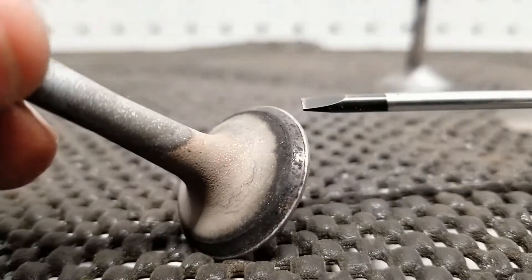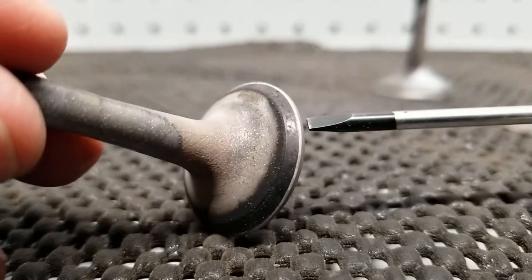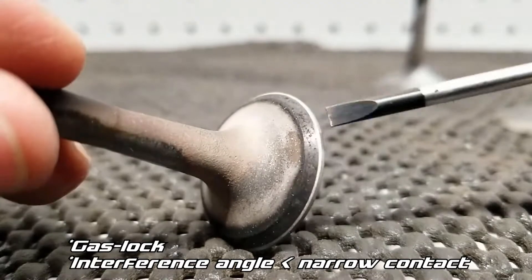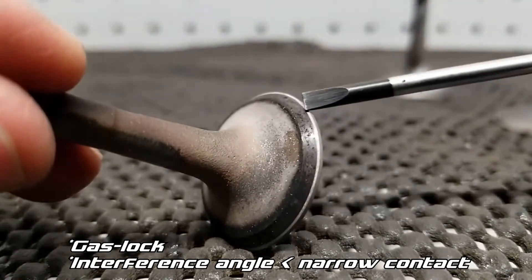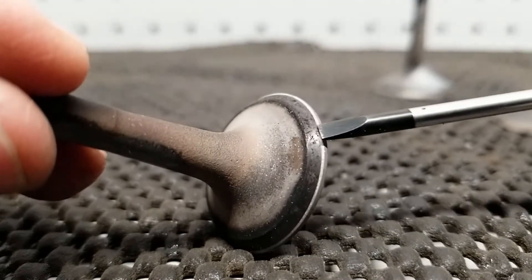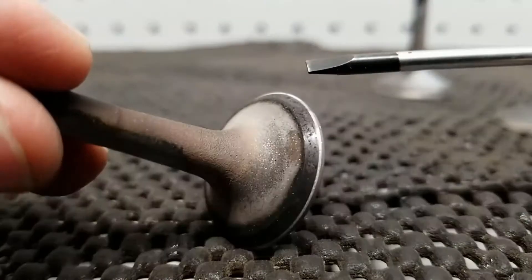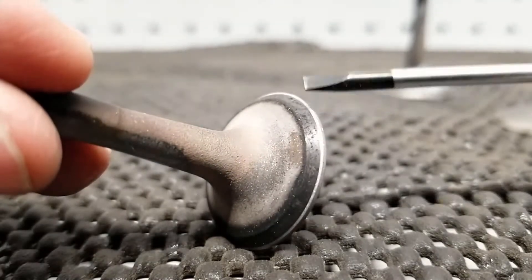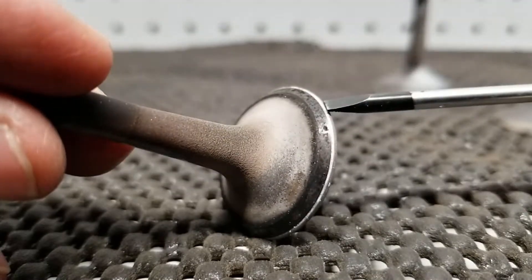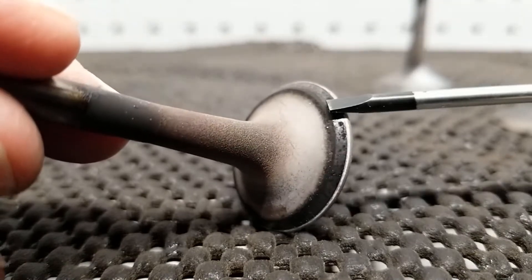You can see where the line is — it's a fine line — but that's where your sealing is actually happening, not here, because you can just see how much crud there is on this. Now, if you hear the term valve hotspots, all of this carbon we've been pulling out of this engine is what you don't want, because every once in a while — and this does not happen really even very often — but there's always a chance of it.